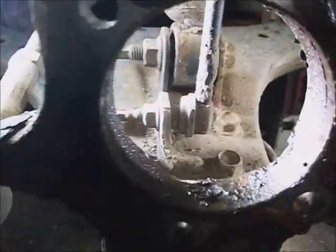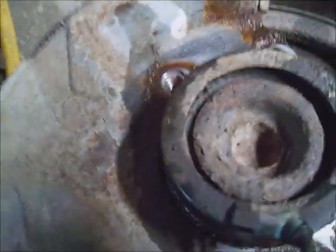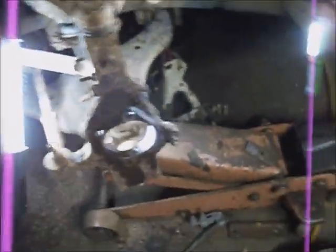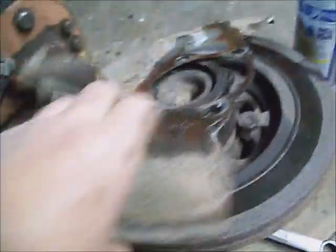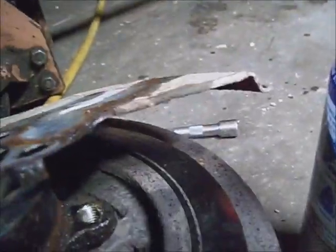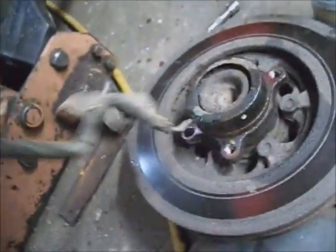Now I got to take some brake cleaner and dry off the WD-40 with the penetrating oil, and then wire brush that down and make sure the surface is flat, and take this cover and wire brush it down and make sure it's not got any raised up places, rust or whatever left on it. And now that it's out of there, slip this cover off. The concave part of the cover faces the rotor. And the ABS cable is kind of aggravating to let it down and bring all those bumps through it. It's really an outfit.